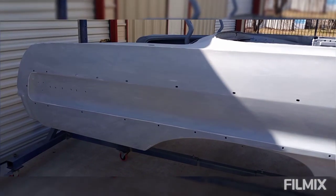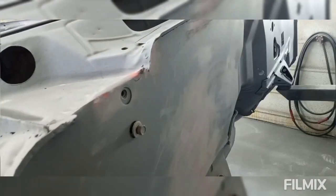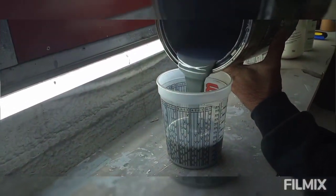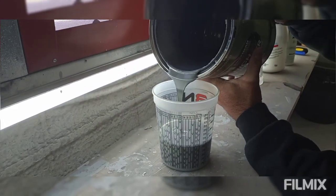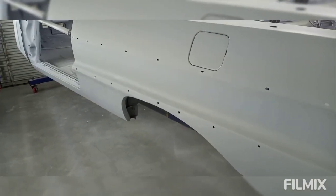We got this thing in one coat so far — one coat of the 2K. All we did was the quarters; we're not going to mess with the firewall quite yet, but we did fill in some pinholes with some spot putty. For this second round we're going to be mixing up about 15 ounces, and that should get the quarters their second coat. We're running a little low on primer. We're spraying with a 2.0 tip as usual — the Iwata Air Gunsa — at about 25 PSI. Does a good job.